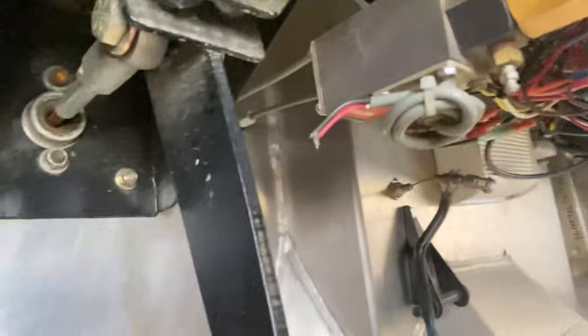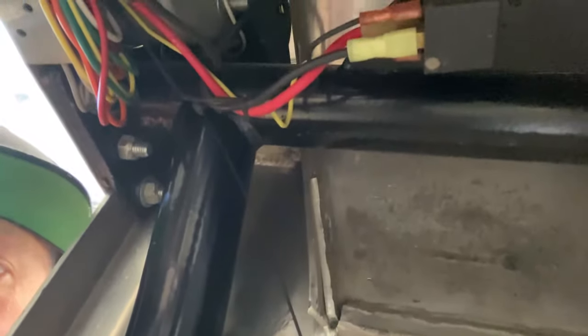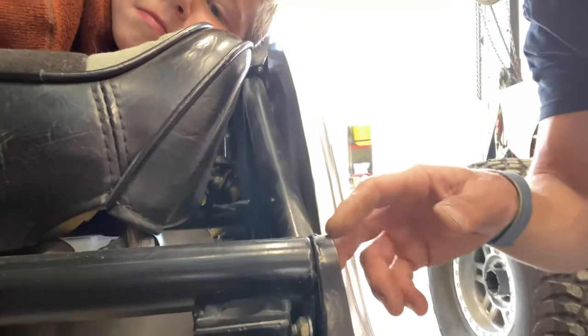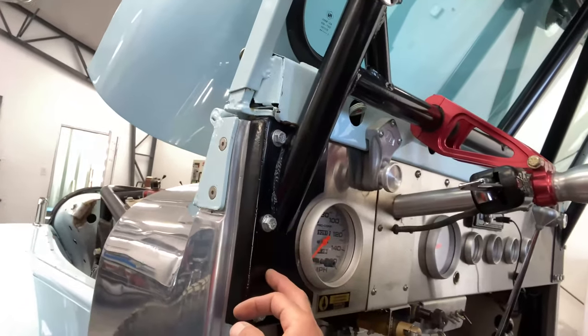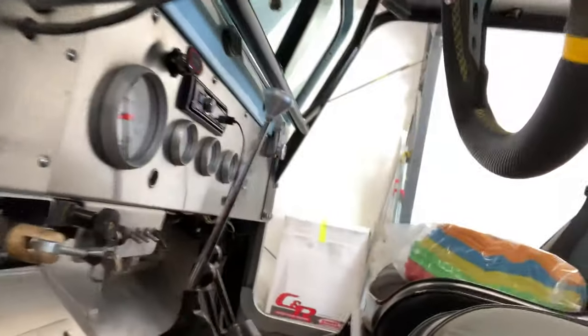Let me show you underneath. I've got a pedal box up here that we built — figured out the swing ratios. Shannon Campbell showed me how to do that years ago on a car, and we incorporated the same thing. Nice long pedal so you can get in there. If you look inside, you can see the cage work that ties all the cages back up underneath the chassis. There's tube work going underneath the chassis, through the firewall, and down to the floorboard. That floorboard piece kicks back in up to the seat mounts, which come back up into the cage and tie it all through. The main chassis tube ties back into the dashboard, and there's a tube running to the firewall and a down tube this way.